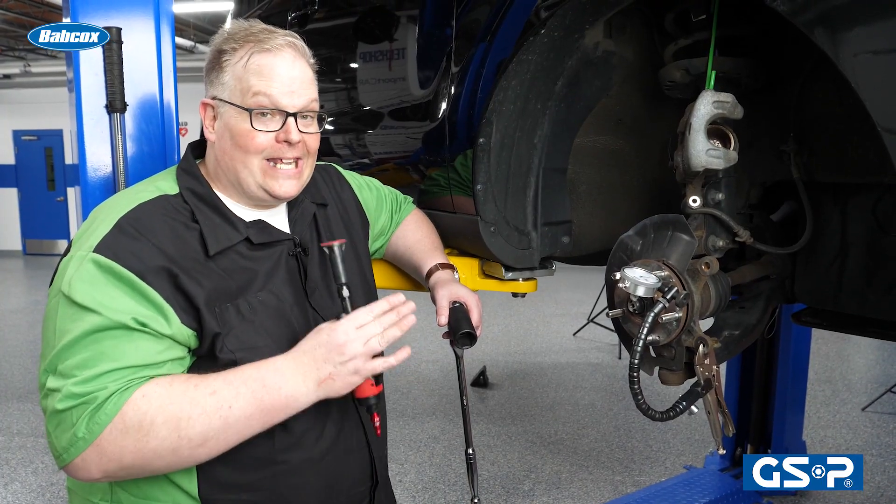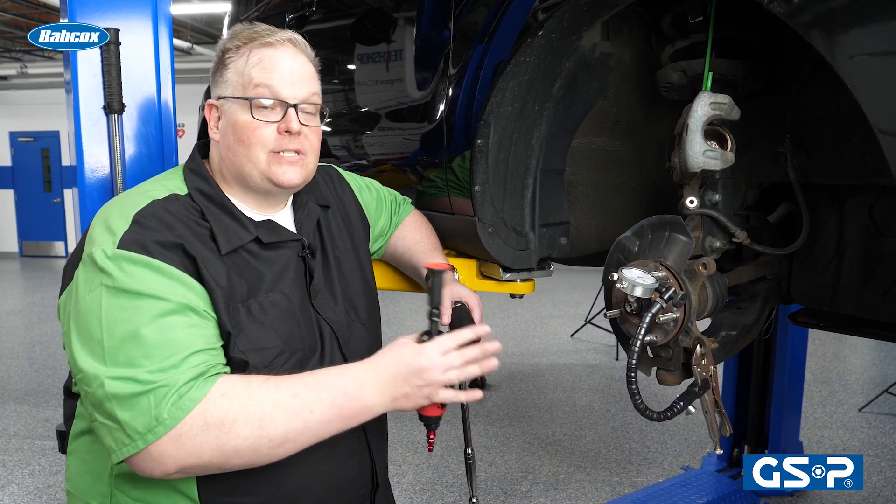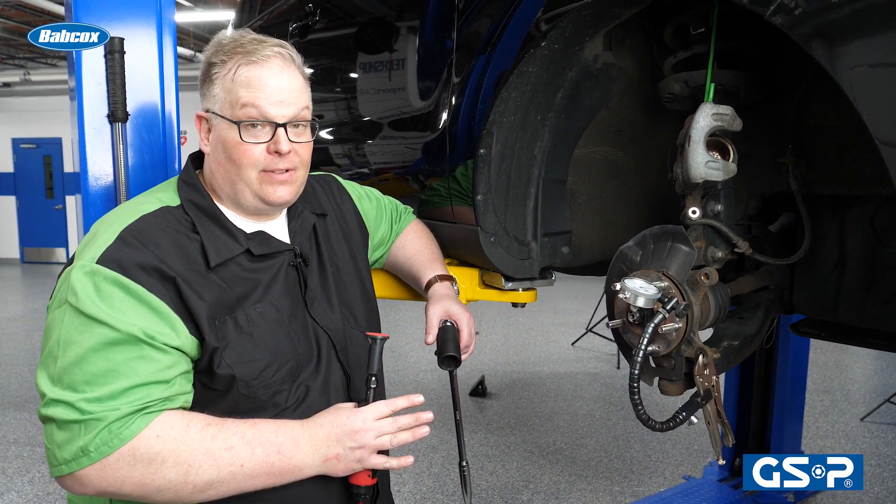You may be wondering how much run out is too much run out. First, check the specifications from the manufacturer — sometimes it may even be zero run out in the flange; in some cases it's 2/10000th of an inch. Keep it very low, or try indexing the rotor to minimize the amount of run out in the flange.